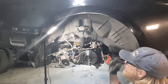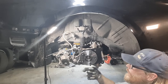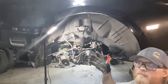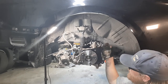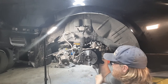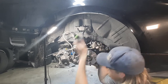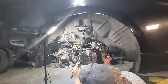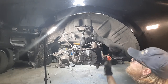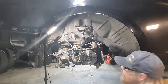The bracket is still intentionally loose. When I torque it down, I think about which way the bracket gets loaded. Driving the car forward it's going to act on your secondary brake caliper — looking at it from our angle it's going to load clockwise, so it's going to push this down. I'm going to hold this down while I torque it so that I take up all the clearance I can in the direction the thing is going to be loaded in the application. Hopefully that'll help make these small bolts not shear or break loose — but if they were to give, the bracket would just make contact with the hub.